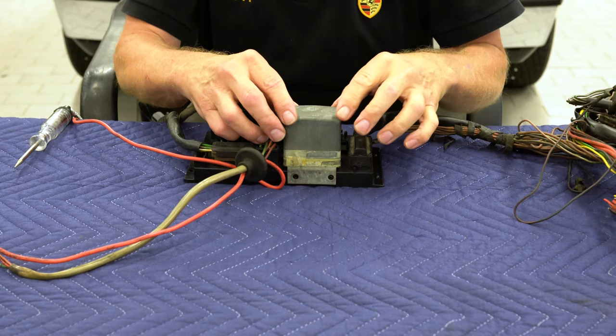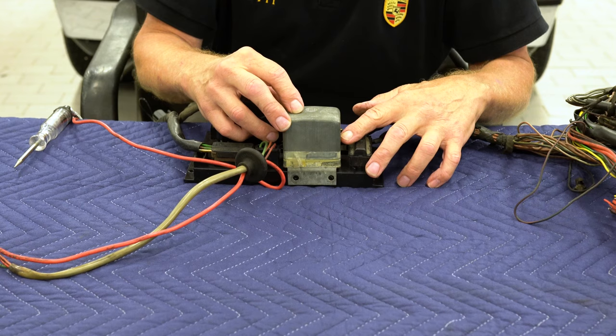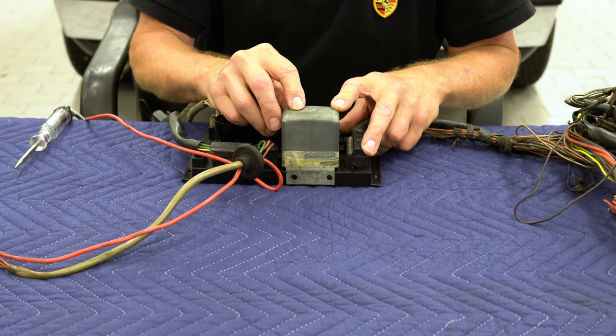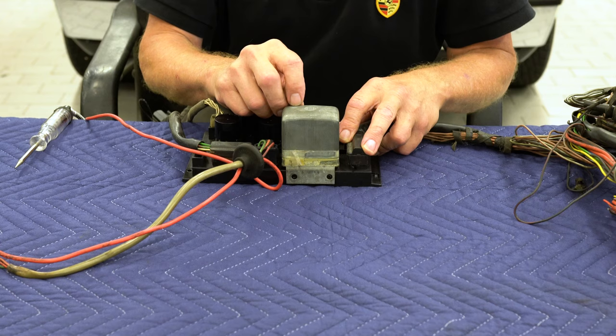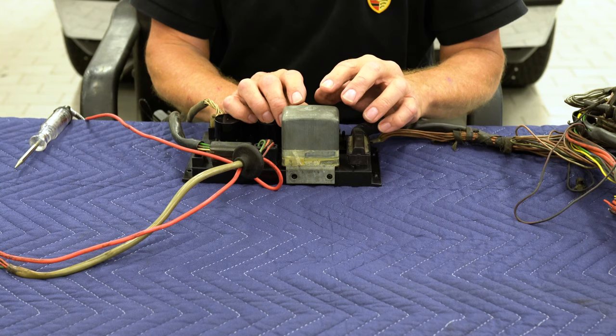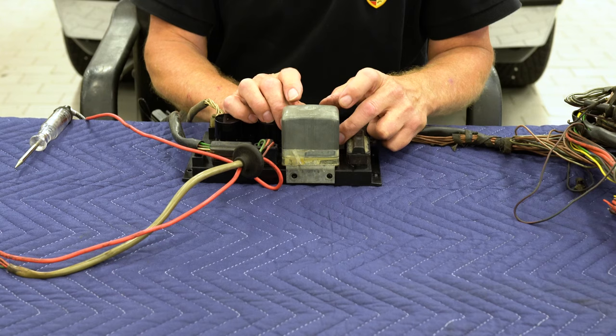Notice the voltage regulator is a tall Bosch unit. The new ones that are made are very short with integrated circuit and they're just fine, but there are many other aftermarket voltage regulators that either don't plug in or don't put out the correct voltage, so you have to be very aware of those. The regulation of this will give you 13.6 to 13.9 volts. If it's any more than that, we know it's overcharging — it'll boil the acid out of the battery, and before you know it you'll have rust in the right rear portion of the 914. Always check to make sure the voltage is correct. Those with the appearance group console have a voltmeter that registers; those without can put a voltmeter across the battery terminals.